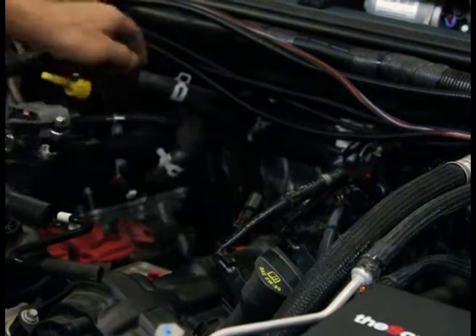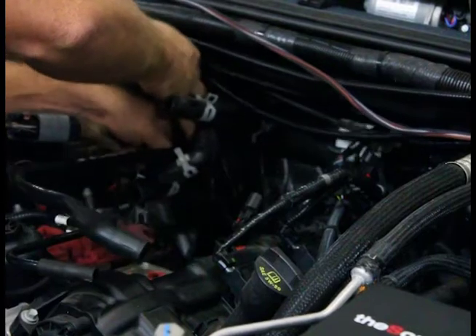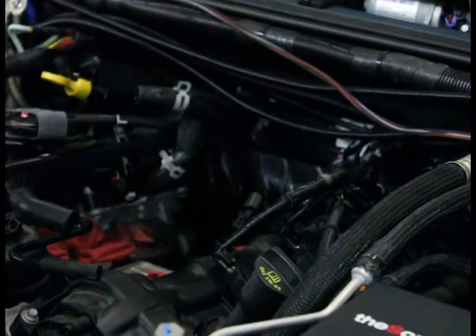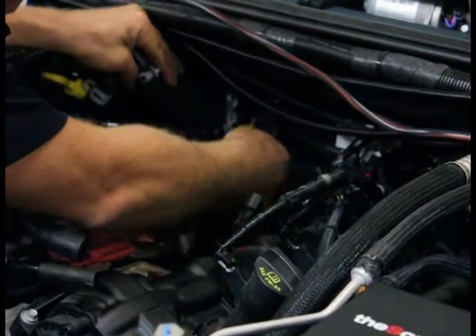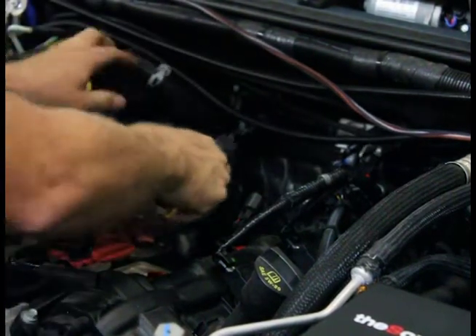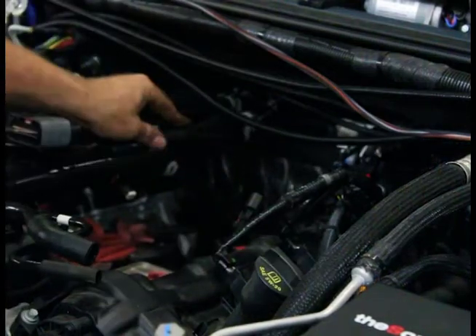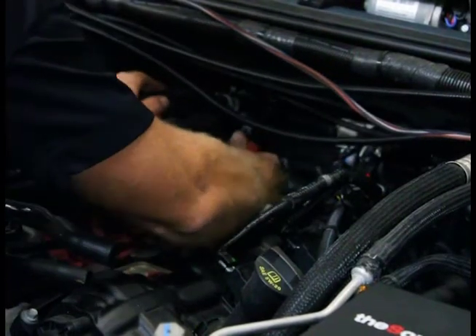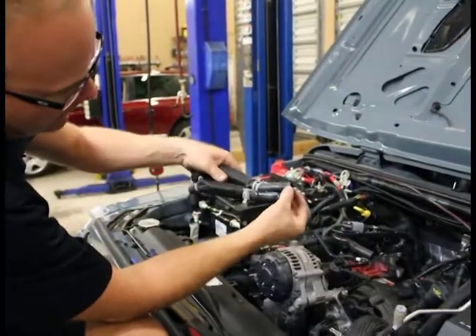Okay, let's get the clamp off the other side and I'll show you exactly what we did with the razor blade. Reach back in there — orientating the clamps is really the tough part. Grab it, get your razor blade, one nice straight slice right where it attaches to the heater core. Make sure you get through there good. You don't want to use any pliers — don't squeeze it, force it or anything, because if you damage your heater core you're done. Just pry it here and it'll come right off. You put one slice here and it peels back.